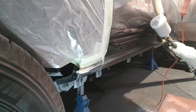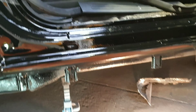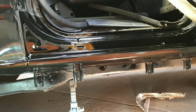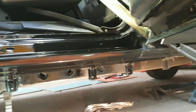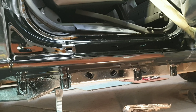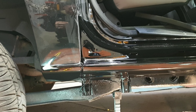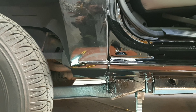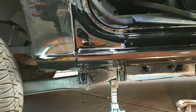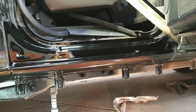There's absolutely no rush — just get a nice even coat. That's now had three good coats of black. It's tacked off; a little bit of dust fell on it where I pulled the masking off. But you can see it's all super smooth and shiny. I just need to polish this back corner up a little bit just to pull it into the new — not a problem. We'll get it all trimmed up and it should be ready to go.